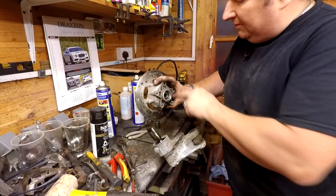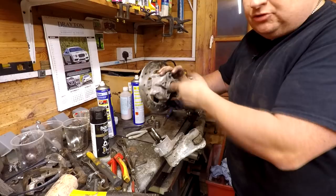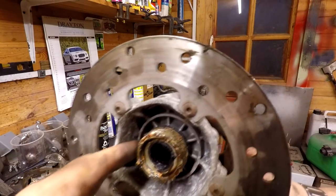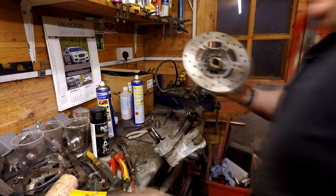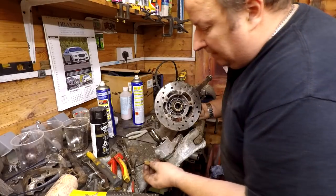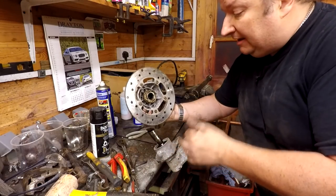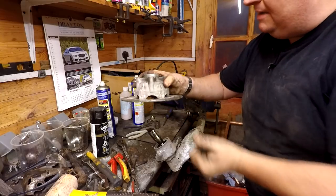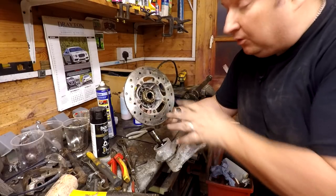Right, okay then — we've got the rotor off. There was a clip in there, as you might have seen in the time-lapse footage. If we were going to take the bearing out — the bearing actually feels good, so the bearing wasn't what was making it stiff. It was this lot in here where the speedo drive runs — this grease in here is totally congealed and solid, absolutely rock hard. Bearing in mind that's running on a little plastic gear, that would have chewed that plastic gear up in no time. The stiffness was what we were actually investigating, and the bearing is as smooth as anything, so I don't really need to take that bearing out. This congealed grease is the cause of our steering stiffness — easily remedied with a good clean and re-grease.